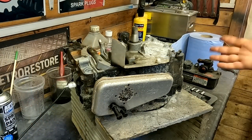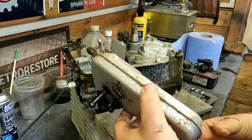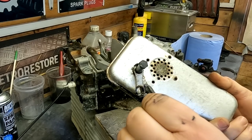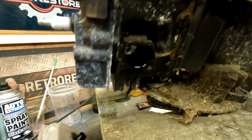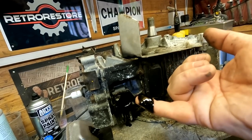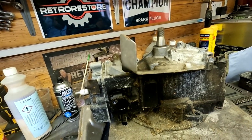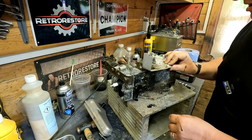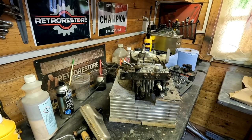So while that paint's going off, we're stripping the engine down now. I'm just about to take this old exhaust off, and I don't know whether you can see or not, but the actual oil that's in this exhaust — it's obviously been tipped up or it's been overfilled, one of the two. Look at the state of them bolts — all the oil on them. If I tip that up, you can probably see oil run out of there. So we might have found our issue. This might not have been a timing issue at all — it could have been hydro-locked. When you try to pull it, there was just too much oil pressure in there; it's saturated. I would suggest this is the problem: it's going to be hydro-locked, and that's why it was really, really hard to pull out of your hand. I might take the head bolts off to look inside the cylinder head and confirm it's been overfilled.